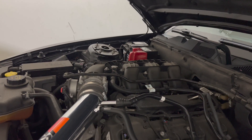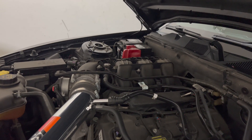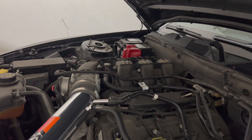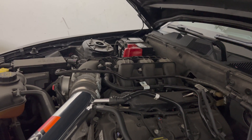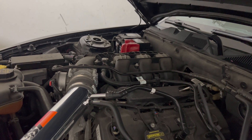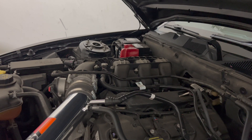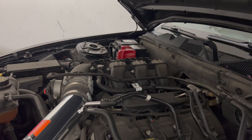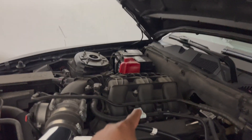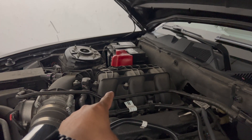In my case, I think there are three reasons that I got a check engine light: one is that I got a bad O2 sensor, two I got a bad cat, and three I got a leak on my upper intake manifold.